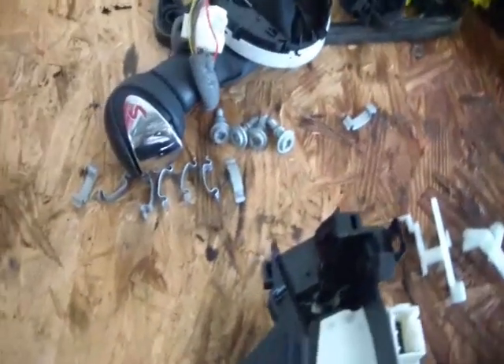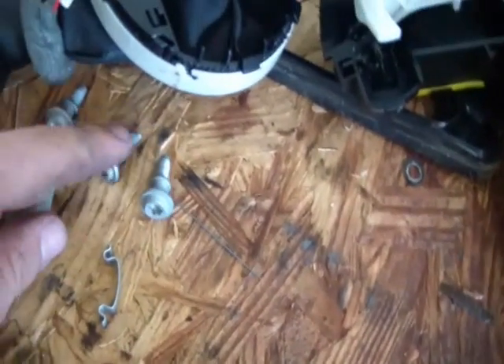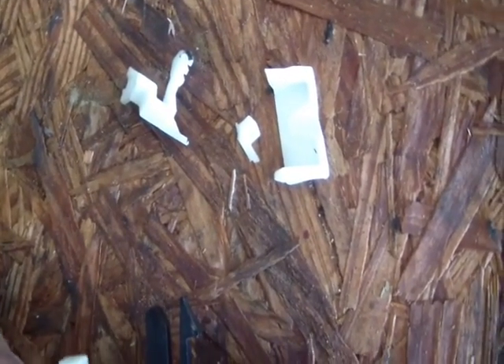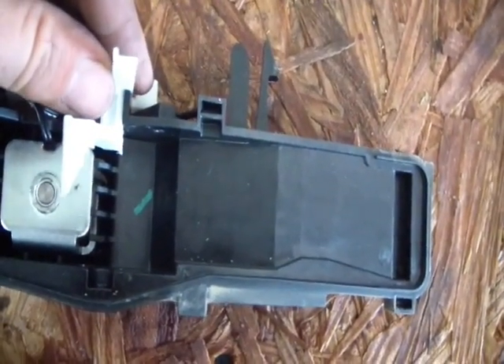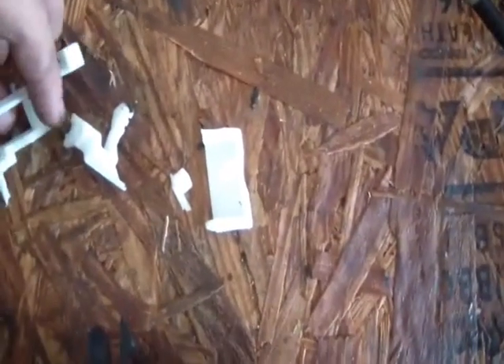I've got the shifter out. The shifter piece is in two halves held together by clips — there are eight clips total. I took off the rubber seal, which holds some bolts in. Here's the shift lock solenoid — you can see where it gets its power — and there's a sensor right on top. This little piece pivots in here, but this poor piece has been shattered into four pieces. I suspected this part is unavailable separately from the whole assembly.